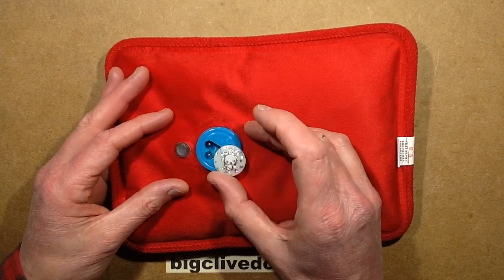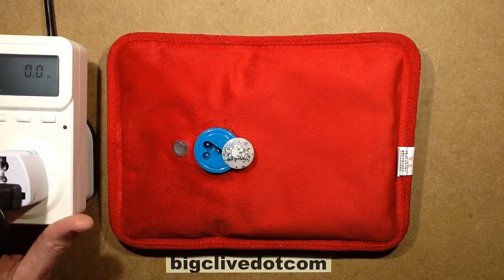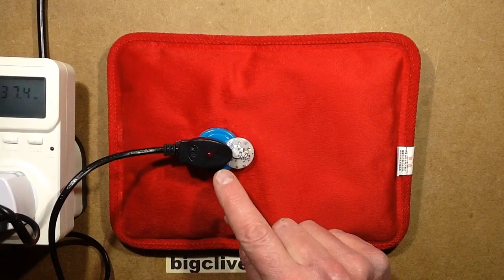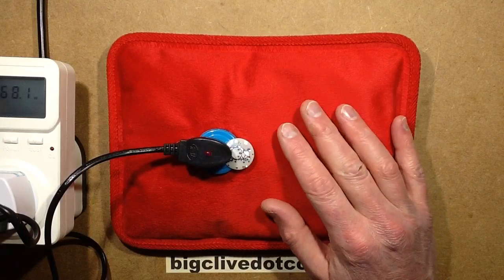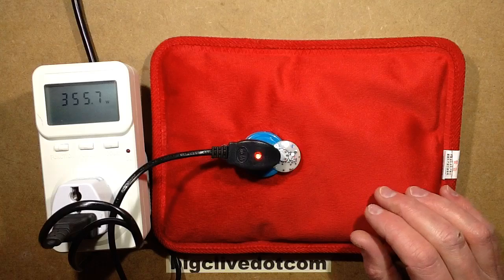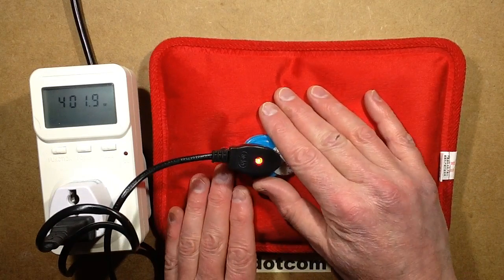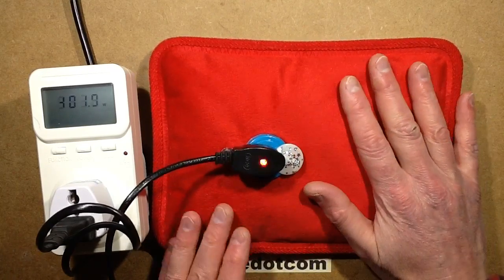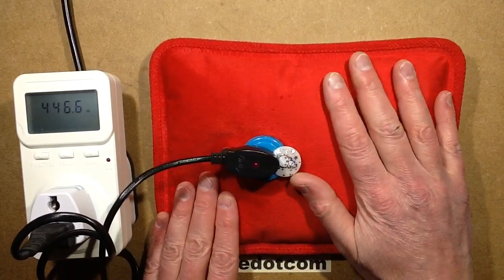So I filled it and then you click this round — it's quite nice, it goes round, you hear a wee sprinkle bing and then it clicks round — and then you plug it in. The connector has an LED in the top of it, so let's monitor the wattage. You plug it in, there's a wee red LED light in the top and it immediately starts heating. It's currently at 355 watts, but if you disturb it at all the wattage changes, because this is an electrode boiler in here.